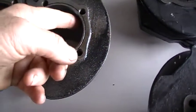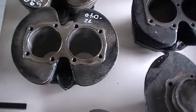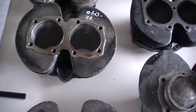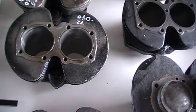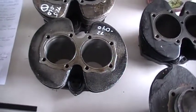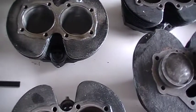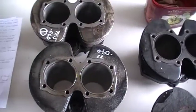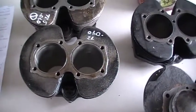They get little high spot ridges just down opposite each of the main bolt holes, and that little high spot then causes problems with the one-piece cast because the bore — the ring sits on four little high spots. When that's the case, it won't allow the one-piece cast to control oil. But the three-piece oil ring doesn't seem to worry too much and it'll control that oil and keep it out of the combustion chamber.